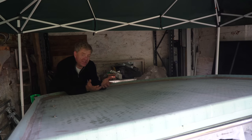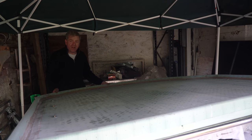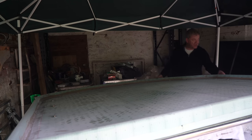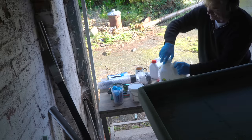What I will say is, once this is done, I'm going to be spraying it with high build filler primer and doing more surface prep on top of the fiberglass. So I think I could keep going forever, and somebody like Matt might say, no, stop, you've done enough, that's fine. So I'm going to just tidy up a few more little bits and then start getting the glass cloth on round this grab handle, because it feels nice. You know, I'm going around it with my eyes closed and it feels okay all the way around. And sometimes that's a good metric for it, is does it look right, but does it feel right as well? And it does, it feels nice. There's no sharp edges. There's no big blobs of anything sticking out that are going to catch anybody.